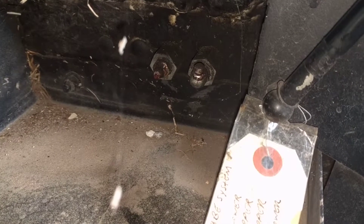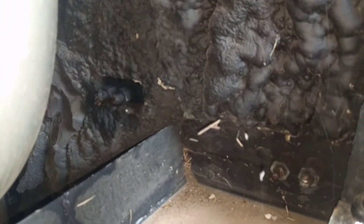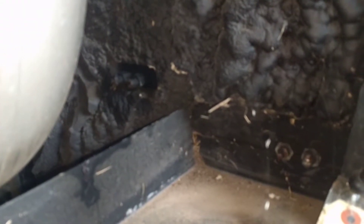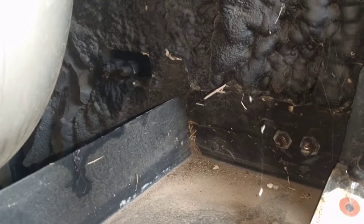If you look in here, this is a modification. You can see right there, there's two grease fittings, two over there. These have been added — this would not come this way from the factory. Basically, those are hydraulic lines under the top and bottom ball joints. So when you jack the front end up and take the pressure off, instead of crawling around under there, you can just grease both ball joints from right here. It makes it really handy.